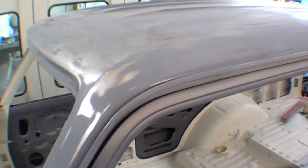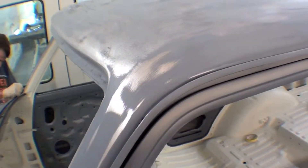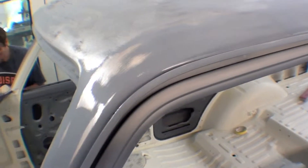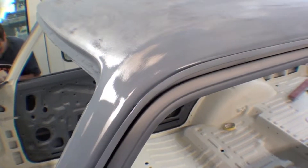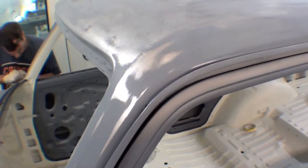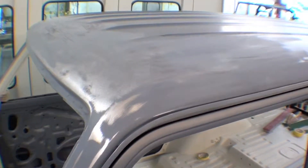What we do is, like the quarter, we put a skim coat of filler on it and block it out so it's nice and smooth. You never notice some of these little factory flaws. We just like to go through and restore them and make them exceptionally nice. We don't like waves, we don't like factory spot welds — we'd rather hammer and dolly them, clean them up with a little bit of filler and primer, and just make it exceptionally smooth. It makes it so we can really sand and polish our paint up to a high level of finish when we're done.